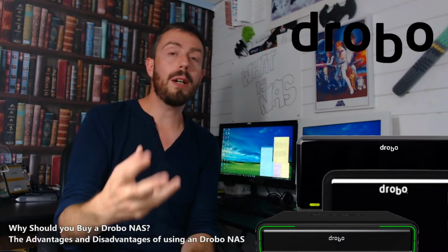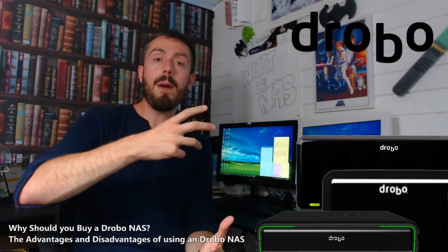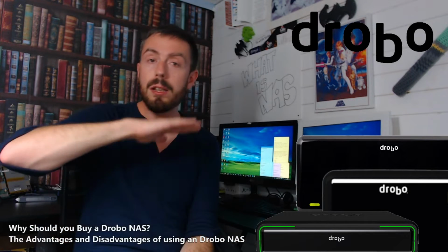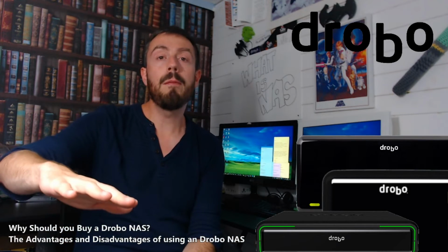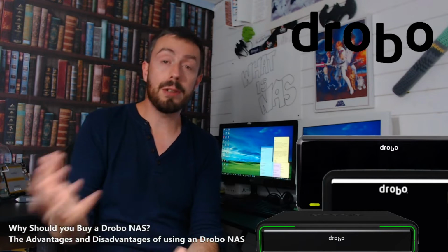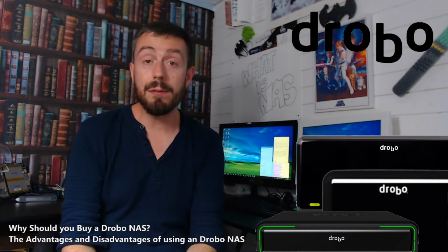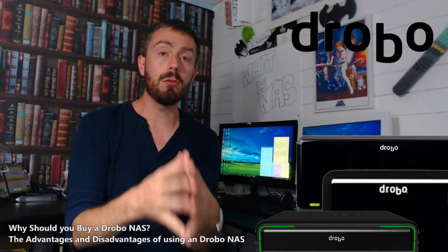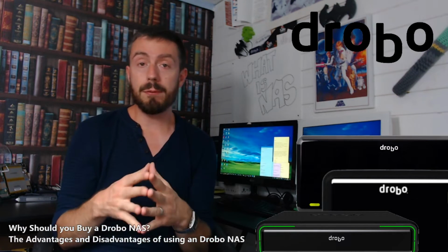And then there's RAID 5, RAID 6 and stuff like that, where you have 1 or 2 disks worth of redundancy that you can lose, but the read and write can lose some speed as the calculation for that redundancy is made with something called parity. Do check out my RAID video. But Drobo arrives with something called Beyond RAID, and what it promises is several things.